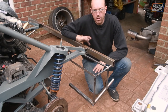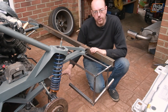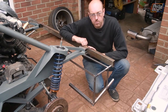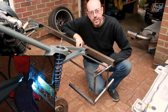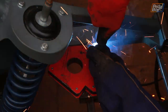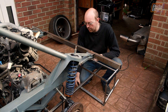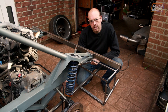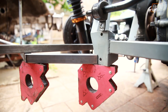That's about as much as I can weld up off the car, because getting from this corner onto the underside of the chassis at the back is not something I really want to do with guesswork. I'm going to make something that fits exactly where I need it to be, so the only thing that comes now is to weld this piece onto the main chassis — I'll just tack this in and then we'll start looking at the bottom. Now we've got this welded in, I'm going to attach this piece onto the back end of the chassis to join onto the lower stabiliser. I've shaped this so it'll come off the very bottom of the anti-roll bar mount and come across to join this piece, and we've clamped it in so we get it at exactly the right level with the rest of the floor.